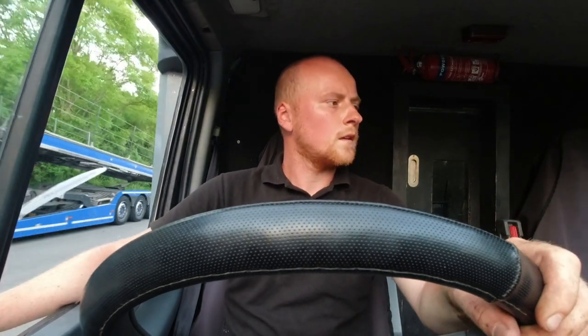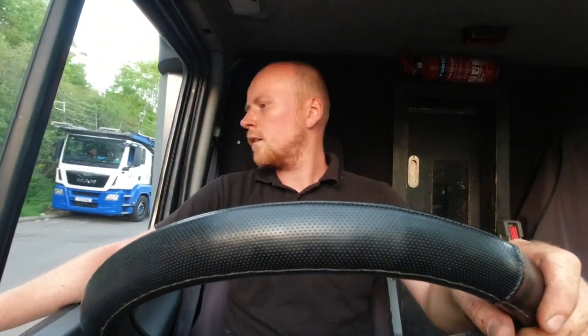But my suspicion was it was the dampener on the coupling. With it being an old unit, chances are it's had it. If the dampener's gone, the trailer's at free will, sliding up and down the shaft and applying its own brakes.